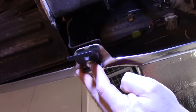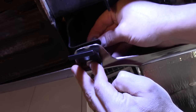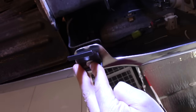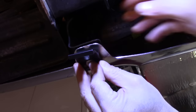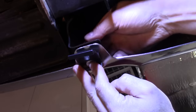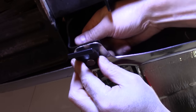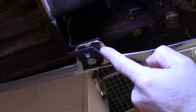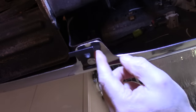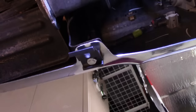I'm going to use a larger washer on the back side here because the diameter of the bolt and existing washer is just a little bit small for that hole. So I'm going to use a larger flat washer, the flat washer that came with the lights, the lock washer that came with it, and then it also included a 13 millimeter nut.